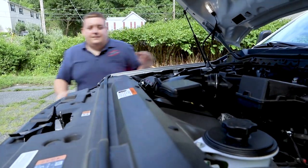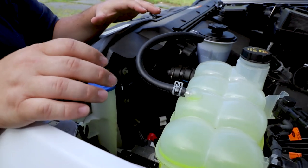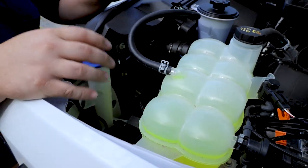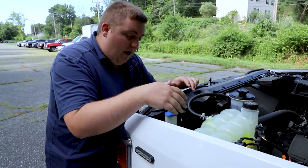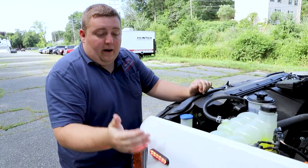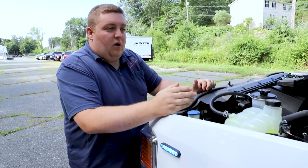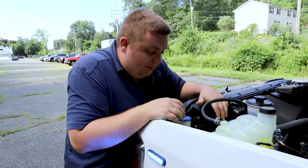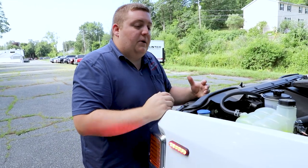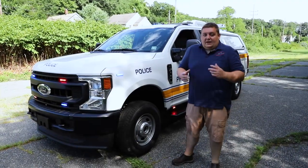On the driver's side fender, we took out the coolant reservoir and fabricated a bracket to house all of our front components. The Blueprint system is multiplexing — we have output nodes, siren amps, the headlight flasher, and fuse distribution here, which minimizes how much wiring we need to run into the front. If we had individual control over every light head we'd need to run one wire per function through the firewall, but with the Blueprint system we just tie it in and the programming takes it from there. This makes a complex vehicle like this very easy to manage and service, because serviceability is key with any project.